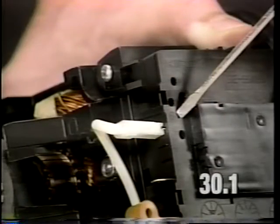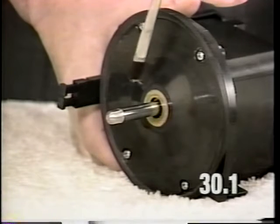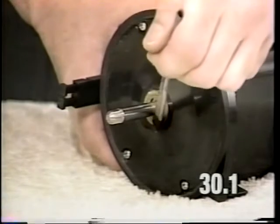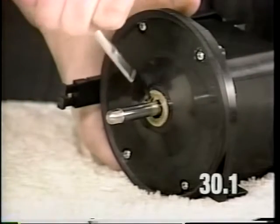When installing the fan assembly, apply a thin visible layer of Kirby Engineering approved T159S grease to the bearing plate eyelet. It is only necessary to apply a thin film of grease in this area.